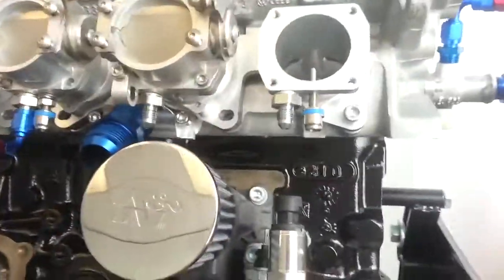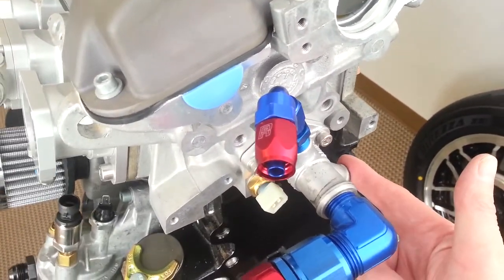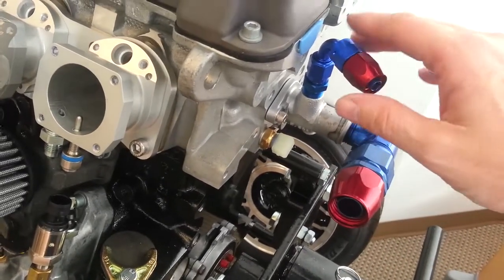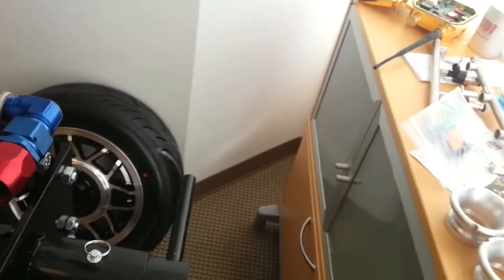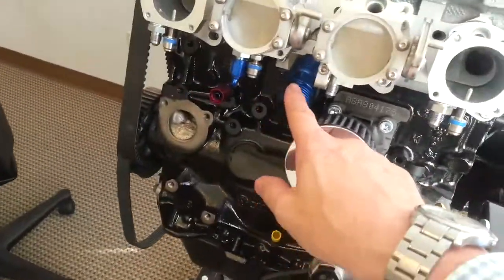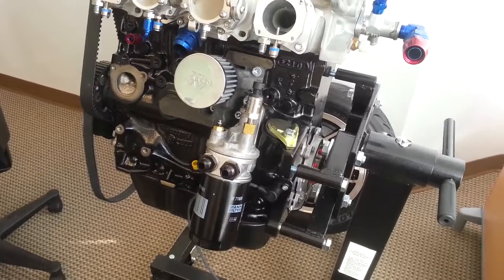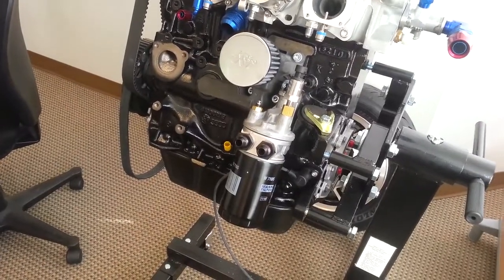On this side there are three connections tapped in. The back one is just the rubber hose that goes to the heater core. This one goes to the top of the coolant recovery tank — the overflow tank — so any air bubbles at the top of the cooling system come out here. The bottom of the aluminum fabricated recovery tank connects to the bottom of the radiator core. This is the secondary outlet, so both outlets tie into my custom radiator, which has fittings on both the inlet and outlet sides, including temperature sensor ports built into the spec when it gets fabricated.